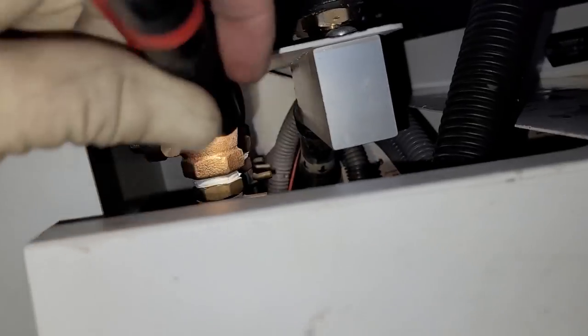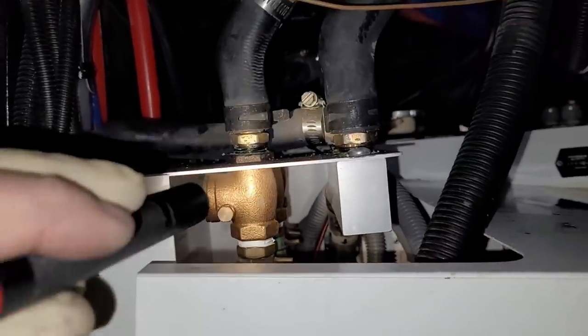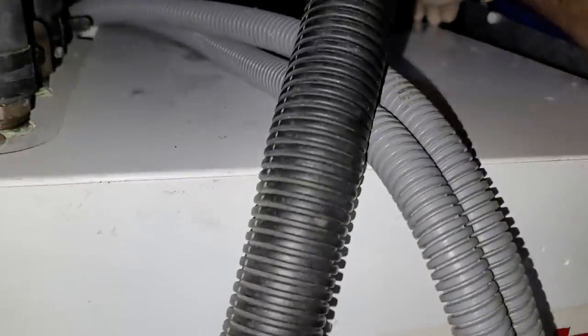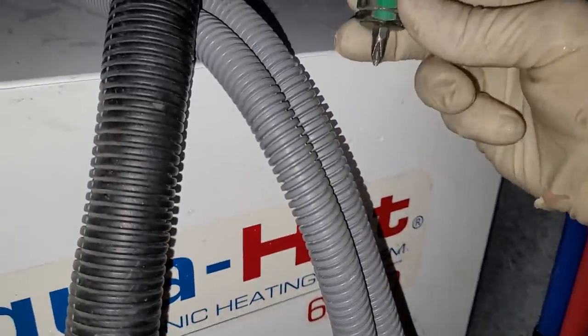Again, that's just a little check body right in there — it's a common plumbing part. It just gets stuck in there. That's AquaHot's own advice too before you change that out. I just got everything kind of lightly put together. There are little tabs underneath here that fit behind the panel so it doesn't come out. There's a screw right over there, one right over, that one right there — that'll be the easiest one to get to. Look at my super fancy screwdriver — this tiny little guy has saved me so many times.